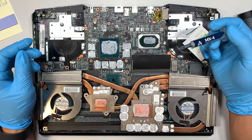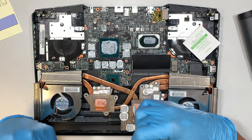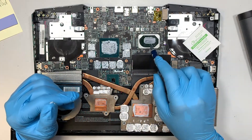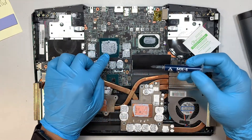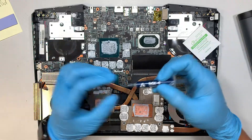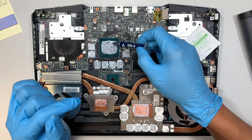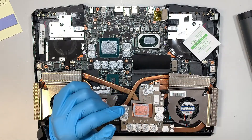I'm not going to show the actual application in this video, but one thing to pay attention to is the amount of original thermal paste — it's quite a generous amount, not just a tiny drop. A lot of websites say to put a grain-of-rice amount, but that's not enough. Try to be generous when applying thermal paste. I like to apply it in an X pattern so you can spread it around all the edges of the plate.